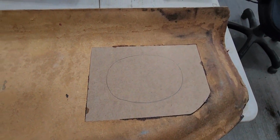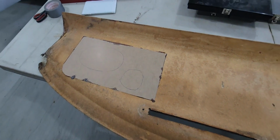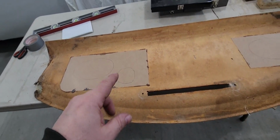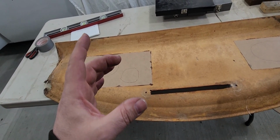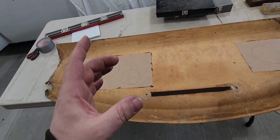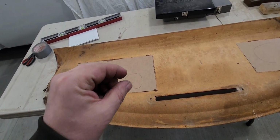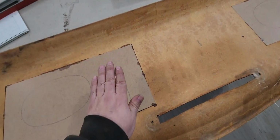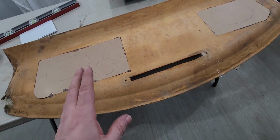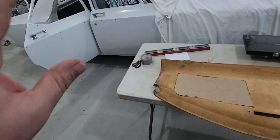All right. Hole for a 6x9 on each side. And a funny little triangle one for that heater. I got in my Amazon basket a nice little 5-inch kind of a semi-gloss black speaker cover. It doesn't have anything on it. It's just a really low profile. I think it said it sits about a 1/4 inch high, which would be nice once I put my fabric over that side. Then what I'm going to do is just stick that down, I don't know if I'll glue it or put screws one way or another. It doesn't look like it has any holes or screws, but on the other side, I'll be able to put it on there. It won't be shiny, so it'll kind of blend in a little bit.